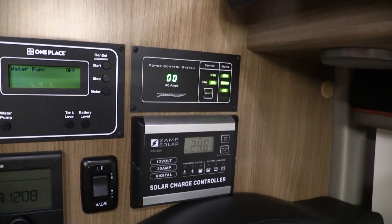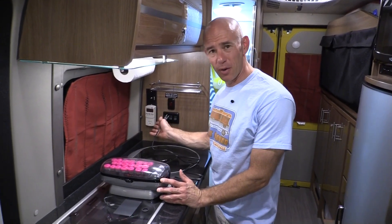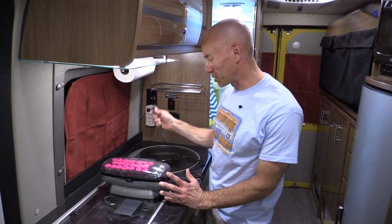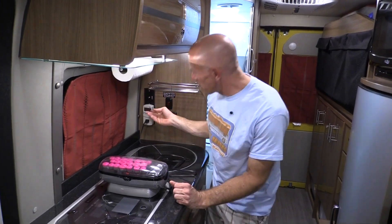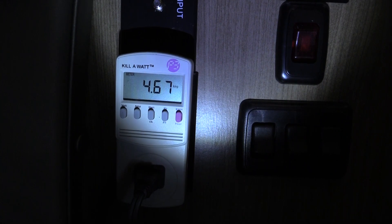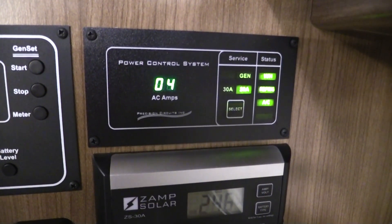It's this little guy right here, an energy management system. It performs a couple of functions, and the first one is it's a very basic ammeter, so you can know at a glance how many amps your coach is drawing. Right now, with just a few LED lights on, you can see our coach is pulling 0.0 amps. I've got my curlers here and a kilowatt meter — something that shows you how many watts or amps you're pulling with a particular appliance. Plugging in the curlers, I'm pulling about 4.5 to 4.7 amps, and the energy management system is reporting a 4 amp draw. So there you go, some basic electrical metering.